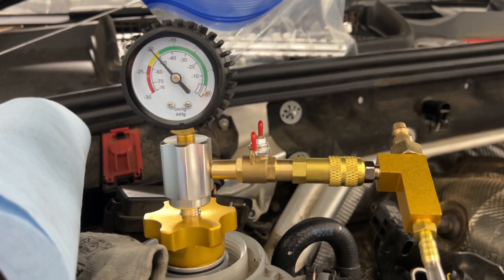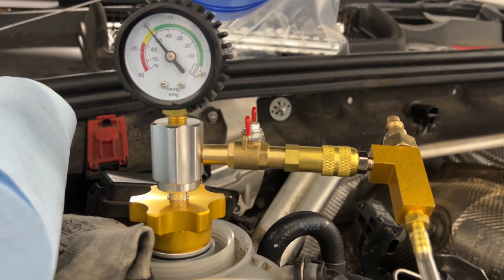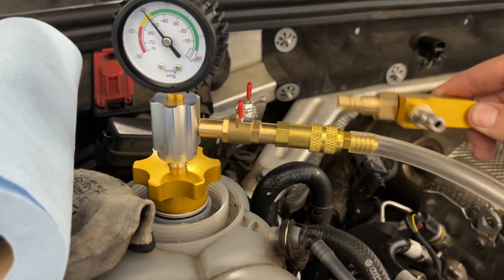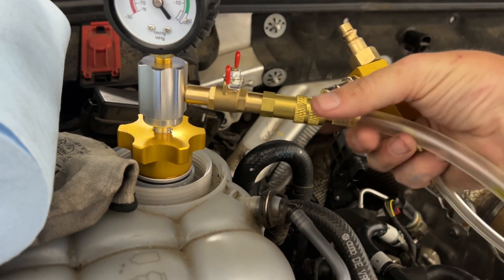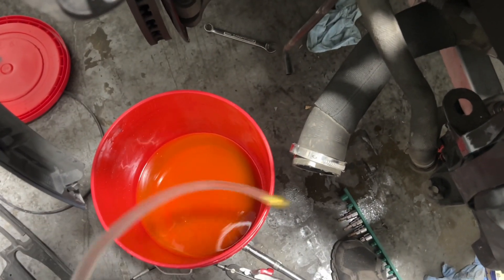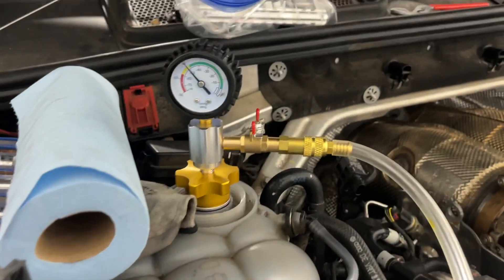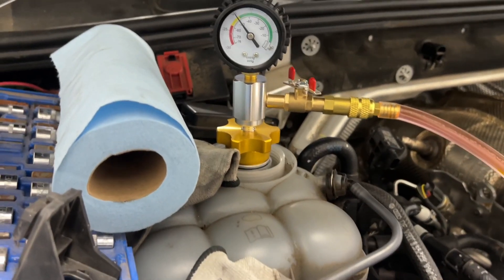The next step is we hook up a hose to this system here, and then you basically swap over from utilizing this system as a vacuum puller to sucking up the coolant itself. Alright, so now we've removed our vacuum block — it actually inserts like so, this thing has a fitting here, so it's good to go. I've got my coolant mixed in a bucket down here, I'm going to drop this little feller into the bucket, and that is going to suck our coolant back up into the system. We're going to slowly crack the valve — and there it goes. We're actually filling our coolant system right now.